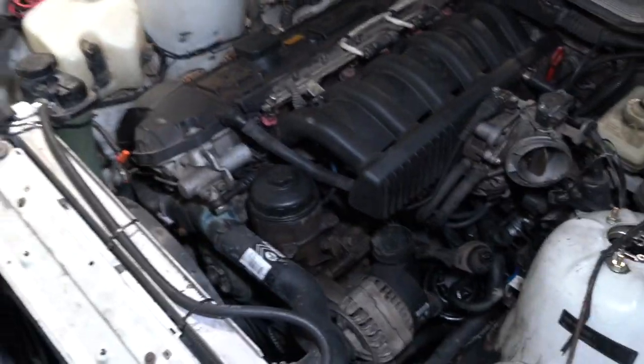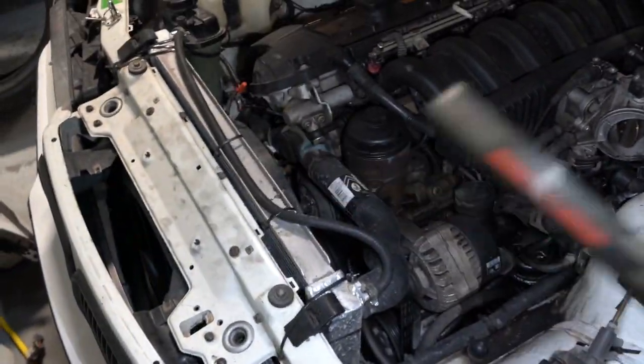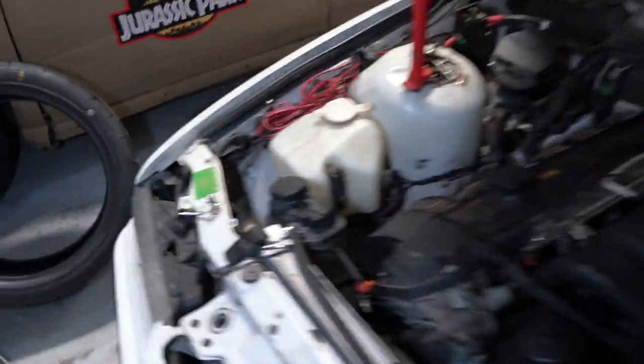So with that motor shifting, it actually pinched a power steering line down at the bottom. I believe it's the little cooler line. So that's why we're pouring out a lot of power steering. Something else I just realized. Yeah, that's not right. So the further I look into this thing, the more I realize what is broken.